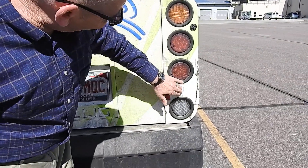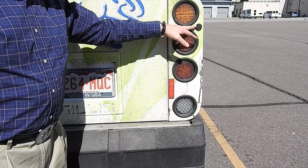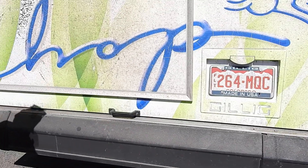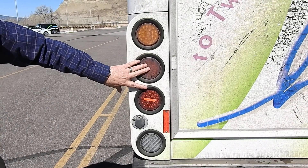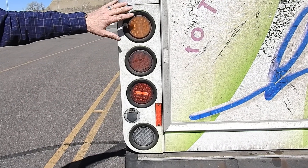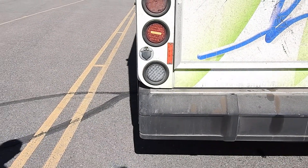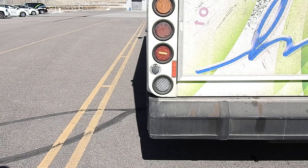The reflector is in place. I'm confirming the licence plate — 264 with the first three letters matching what I noted at the front. I check the left turn signal and four-way, brake light and tail lights. The lenses are not cracked or broken, and the seals around them are intact. The reflector unit here is not cracked or broken and is properly mounted, as is the rear bumper. Double-checking, no leaks underneath. That brings us to the end of the outside of the vehicle.